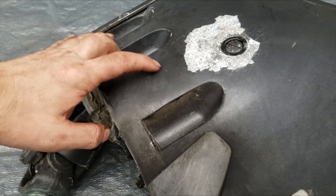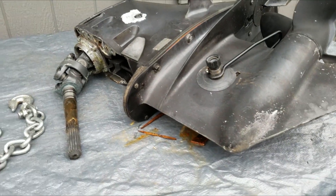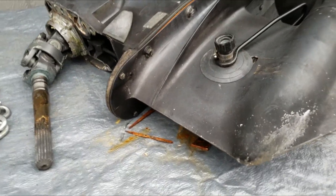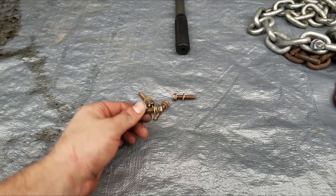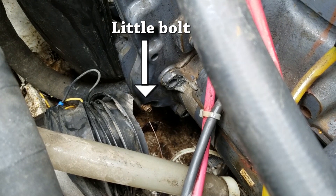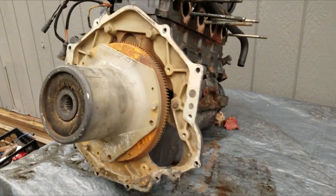There's only six bolts — three on this side, three on the other side — and then the two rams. If you take all that off, this thing slips right off. It's about a hundred pounds, just too easy to do to not take it off. And then the last thing — every bolt, and I want to make it absolutely clear: there are these little ones and you would think they're just for holding accessories on there, but no, these still need to come off because these will absolutely prevent the engine from coming out. Outside of that, not that bad.